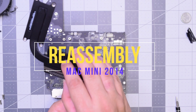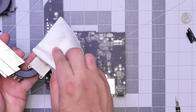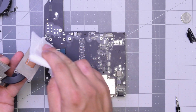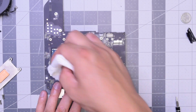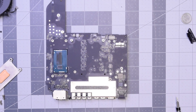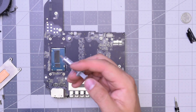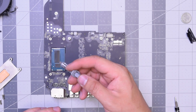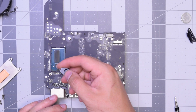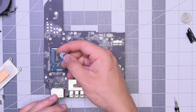Reassembly: If you've purchased a used heatsink, make sure to wipe off any residue from the previous installation — you can do this with a cloth or paper towel. The same goes for the CPU — make sure all the thermal paste is wiped off and it's a nice flat clean surface. Now go ahead and apply thermal paste on the CPU die — the small one right here — just one dot, and then a stripe line on the GPU.